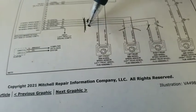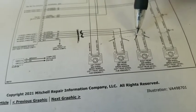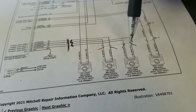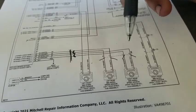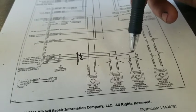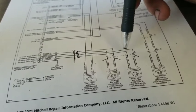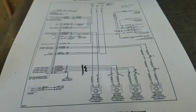The open is somewhere between the connector under the driver's door and the connector by the fuel tank, in front of the left passenger rear wheel. Now I've got to go searching and start taking things apart to find where the break is. I've already pointed out some areas that are possibilities. My tactic is to start at the most obvious suspect — that area I showed you where the harness had been rubbing on the bracket near the fuel tank. We'll be back with what we find.